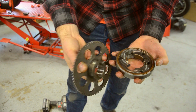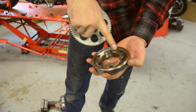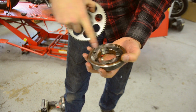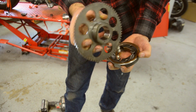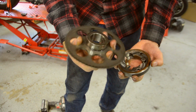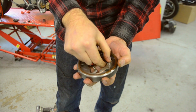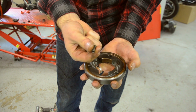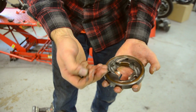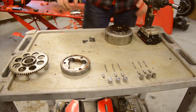So we're just inspecting this part as well. Sometimes this outer Sprag clutch housing can get a crack or something in here. And this one looks good, and there are no significant dents, cracks, flat spots, anything going on with the large gear here either. Underneath here, there's the roller. These are referred to as a pin. And holding all of that together is a spring. We'll be replacing all 3 of those components on all 3 spots there.